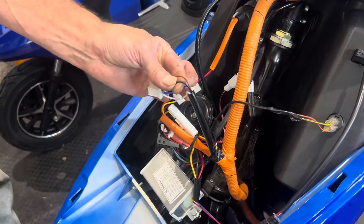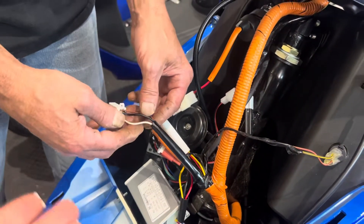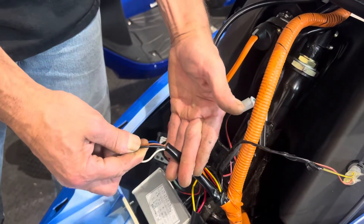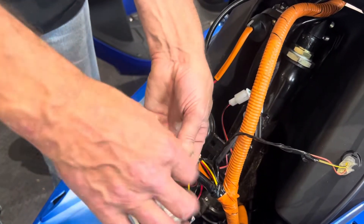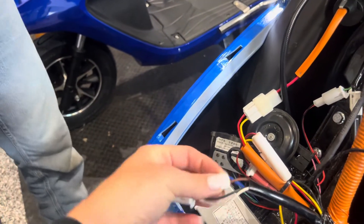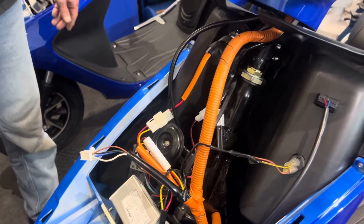So if you want your glow lights to come on with the park lights, splice into the park light wire and ground. What I do is cut back the wire to give myself some room, sever both wires completely, then take whatever you're tying in, put it on one side, cover it with a heat shrink tube, and reconnect the original wires. You can also solder it. Do not use the press-in connectors with pliers — they corrode and cause big headaches.